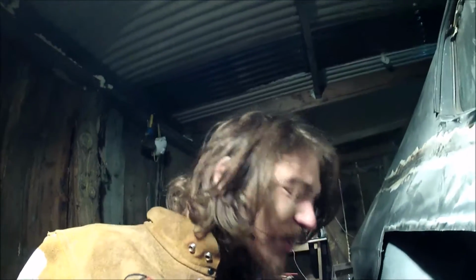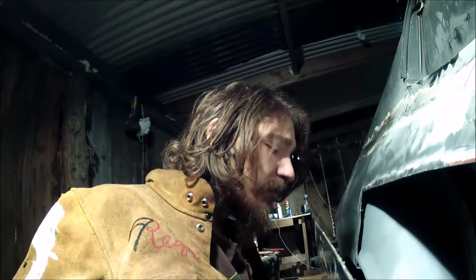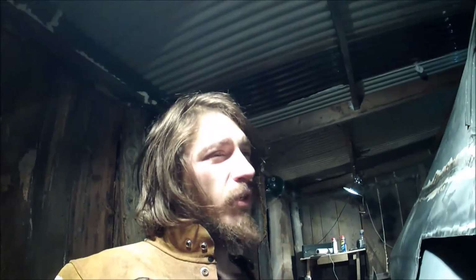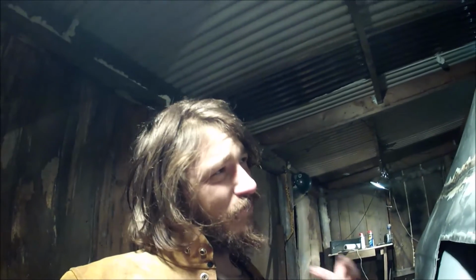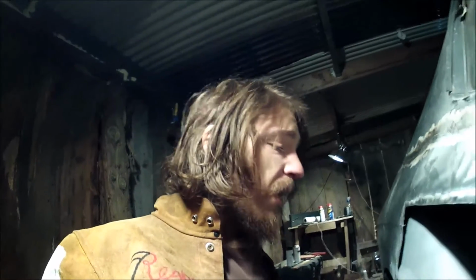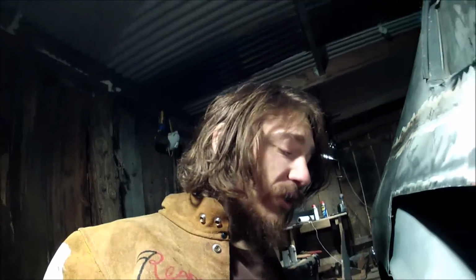I think that'll work a little better than trying to get in from the inside of the car and make sure I actually get these solids. I got this panel all spot welded up on the bottom. And since I've got it open and have access to it, I went ahead and siliconed that whole seam down there, because that's kind of a water trap, and it's designed to drain any of the water that usually comes in from the quarter window up here, which seemed to be a pretty common problem. When I get around to getting close to being done with the car, I'll try and fix that area so it doesn't really leak into the quarter. But in the event of any moisture or water that does happen to get in there for any reason, I've siliconed the whole bottom and that seam and over the top of the weld since it's open. That way we don't have to worry about rust or water corrosion down in here, and it kind of drains right into those drain holes.